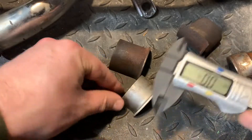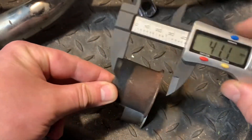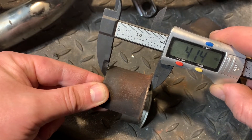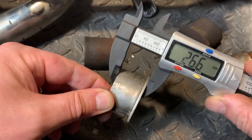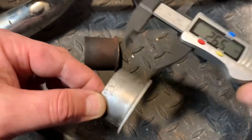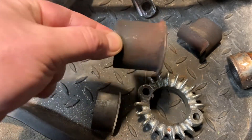Just for reference, let's measure these up and see what the difference actually is. If you have the older style pipes with the flat, really thin edge, you're going to want to come to these — and this is going to be 41.4 millimeters. That's your longer one for the older style, the '68 through '70. And then as you get a little bit newer, these flanges are 26.5 millimeters. That's a pretty big difference when you're trying to get this stuff to pull together and go onto that engine. You want the shorter ones if you've got the newer pipes, the longer ones if you've got the older ones.